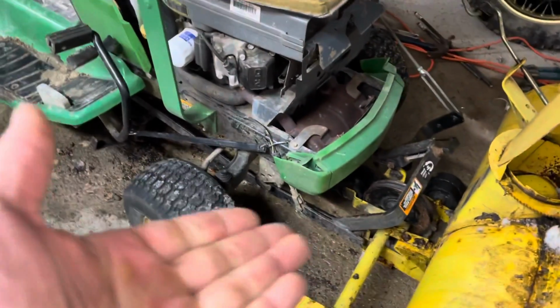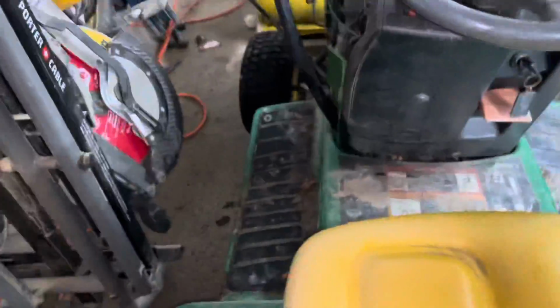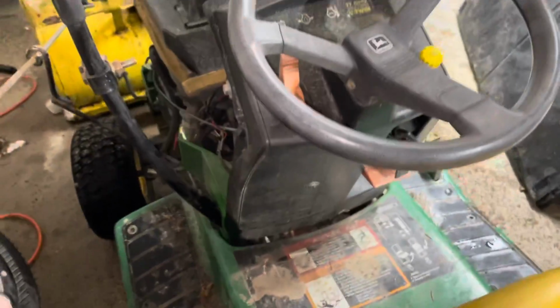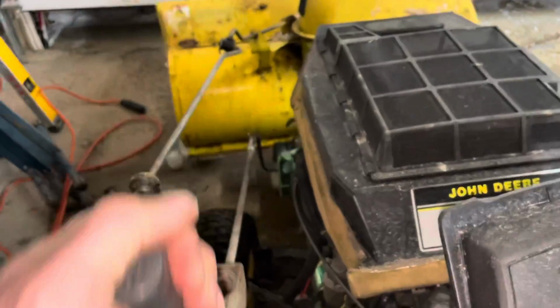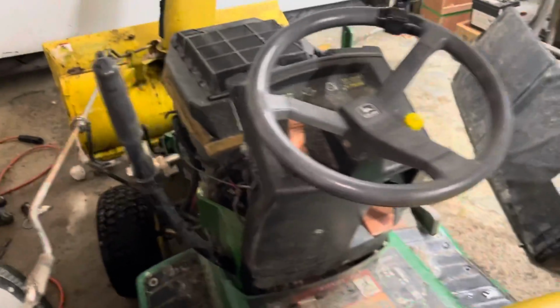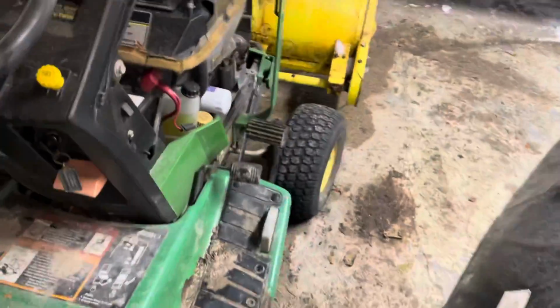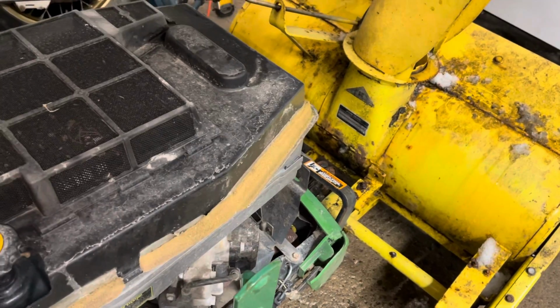And this is how the snow thrower works. But wait, there's a bit more I want to show you. It's very important. And a properly done one will work in both formats, being lowered and raised. That is raised up about 4 to 6 inches. It'll still run in this position. A lot of people have trouble because the belt slips off.